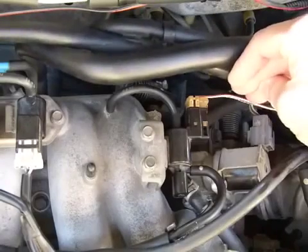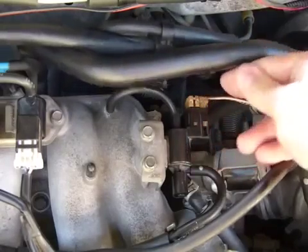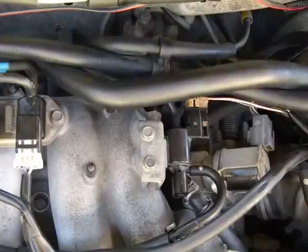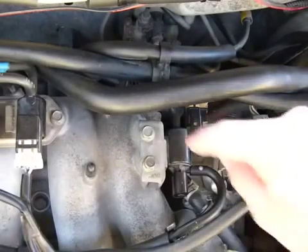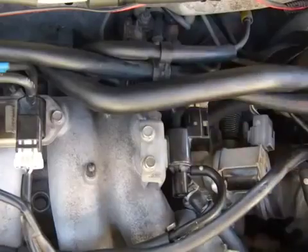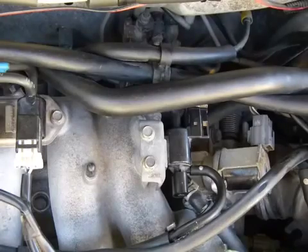I do know that the engine code I deleted with the code reader did not come back after a month. So this is what I would call a jiggle-and-clean operation. It doesn't quite conform to the service manual - that was for the Protege5 and this is just the Protege, same year - but no more engine light, no more trouble code. The solenoid works. It just needed good electrical contact. If an old connection has just one grit of dirt and it sucks in just a little false air, it can give you a trouble code.